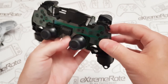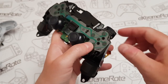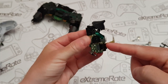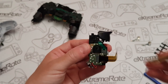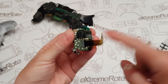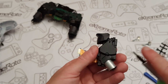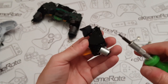Now we've just got to focus on the trigger assembly. There are two screws — one there and one there — and removing them releases the trigger. Once those are off, focus on the right-hand side trigger. There's a tiny little ribbon cable here — the green one — which I'm going to remove with tweezers. Hidden behind here is a little screw which I'll quickly remove. Then if I turn it over, there are another three screws — one there, one there, and one there — and this lets you remove the cover.